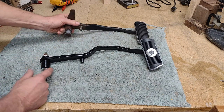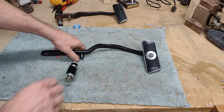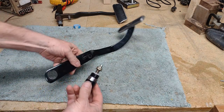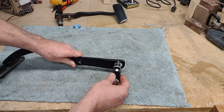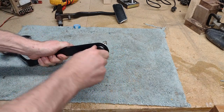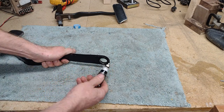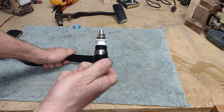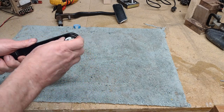They sent me this pedal and it looked real nice, but while I was putting it in the car, it broke. The fellow at the company said it's supposed to be spin welded — they put the insert in and spin it so fast that it fuses the metal together, actually melts it. But this spin weld didn't work: if you look closely, there's spray paint on the shiny part and even inside the hole, so it was never attached.